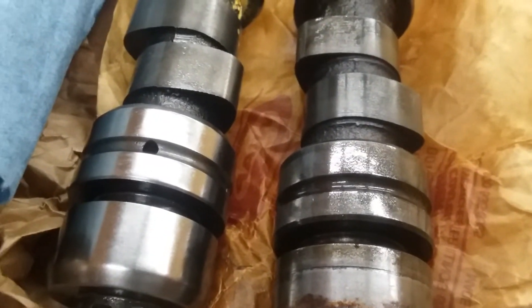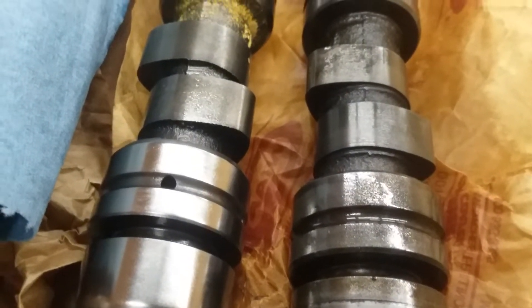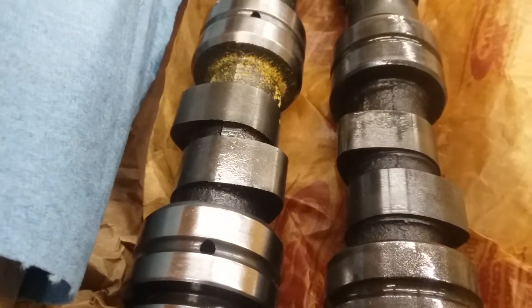These do have a taller lift than these. I'll put down what the specifications of each should be in the description, but the old cam on the right is supposed to have about 0.225 inches of lift, while the high output cam is supposed to have about 0.240 inches of cam lift. They didn't say anything about the duration, but I did measure it out. The high output cam does have better — or taller — lift, and it also appears to have longer duration.